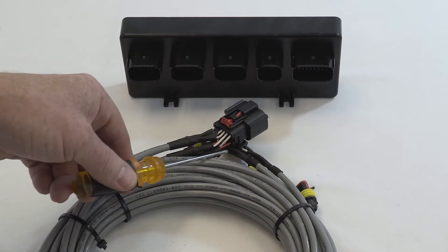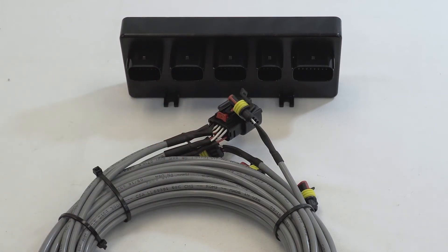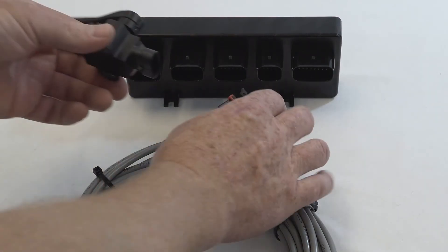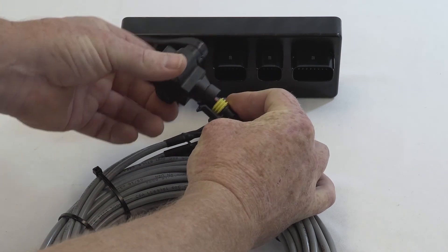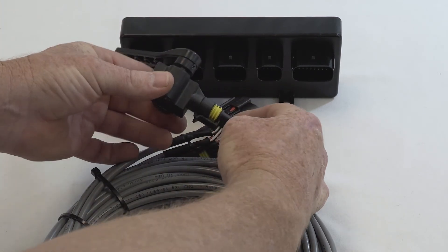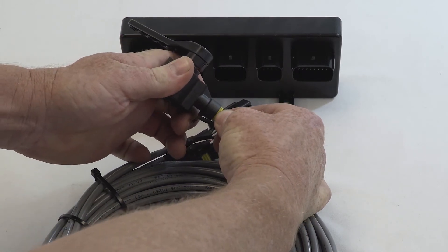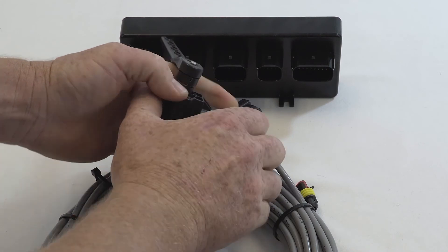Each of the corners have a plug with a clip on it. When you're connecting it to your height sensor, you need to have the clip on the bottom or the side that is mounted to the system. When you push it in, it needs to go in square, otherwise it won't read. You'll hear an audible click when you push it together.